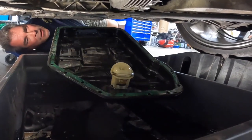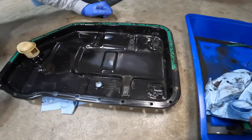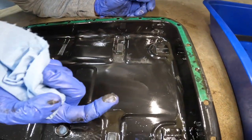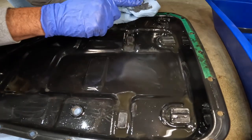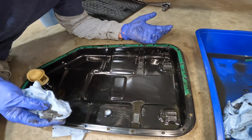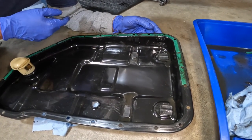Got the pan down. Let's take this out. We'll clean her up and let this drain a little bit more. Just kind of looking at the pan here. You got your magnets in here. There is some sludge on there. I'm not seeing anything much like when we did the Macan. There's no big flakes, just some smudging. I'm going to call this a win for right now. I'm going to finish cleaning it up, take the rest of this gasket off, and by the time I get this done, we'll be able to go take the filter off underneath.